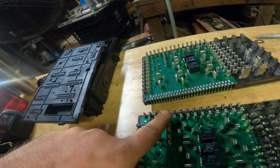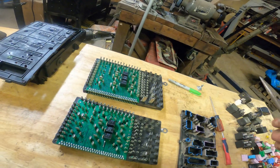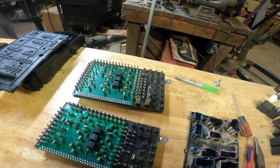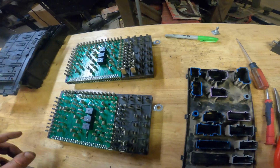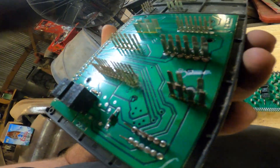My plan was that anywhere I didn't have fuse inputs on this side, the pegs were in place — and you can actually pull these off with pliers and move them. So if I wanted to add fuses, I'd just pull it off one peg and stab it onto where I needed it. Well, turns out I didn't see completely right, because this post is missing on this one — and so on — two missing here that are in the other one. So back to square one: we're going to repair the corrosion on the original board.